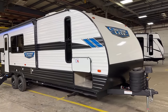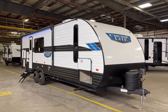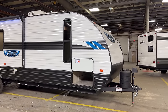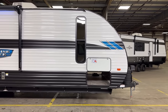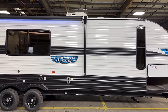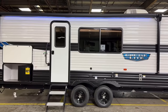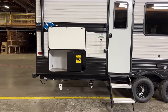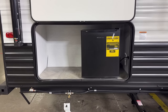In terms of the physical build and body: you might notice it still says 'Cruise Light' on the front — or if it were a Wildwood with orange decals, it would say 'X-Light.' For those uninitiated, Salem and Wildwood are quite literally the same thing — don't let someone try to tell you one is better or different than the other. Where they differ is when you start getting into the different subsets of the family. Think of this as Cruise Light Jr. It's the same 3/8-inch OSB roof deck, walk-on roof, 16-inch on-center roof trusses, 12-inch on-center wall studs, 5/8-inch tongue-and-groove plywood floor decking.